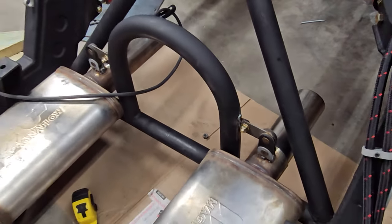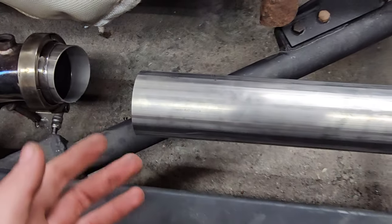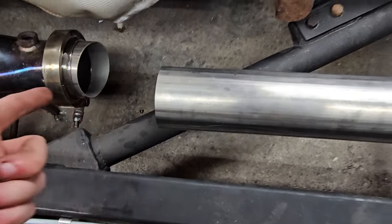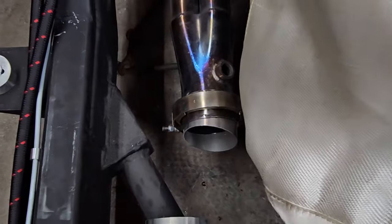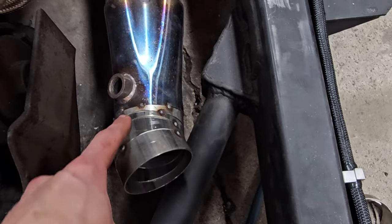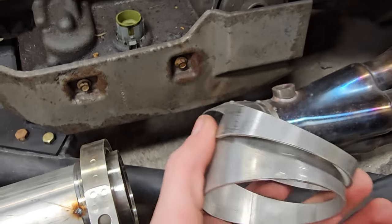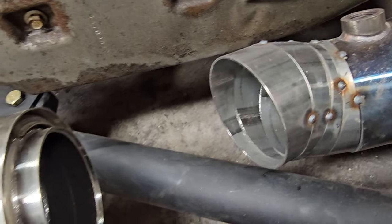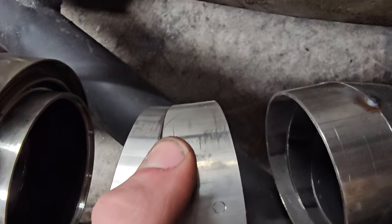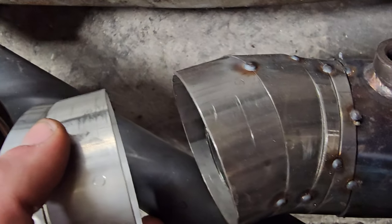With both hangers done, it's time to finish the exhaust. I just have to fill in two gaps. The reason the v-band is on the header and the other v-band is further back is because the v-band won't fit right in there — it's gonna hit on that crossbar. So there's gonna be a little extra pie cut action to get it up there. I've been eyeballing it and it looks like it'll finish off real nice. So I need to measure out those two pieces, run to the shop where the chop saw is, cut them, and hope they fit.